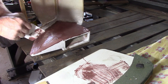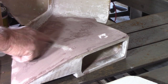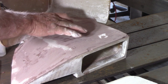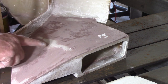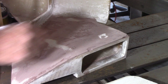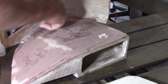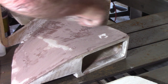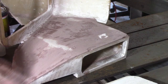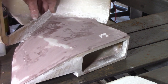That's already starting to go off - I'll have a quick clean up and put it out in the sun so it can dry quickly. I think another coat will do this - you can see I'm down to the fiberglass in spots, and the only really low spots are where the sander hasn't touched it. I've just got to fill these really low spots and I'll put a nice radius on here. The last radius I did go well, but I've put some glass over it since then and it's roughened up a bit, so I'll put that radius back. Once that dries, that will be good enough to glass over and finish off the glassing.